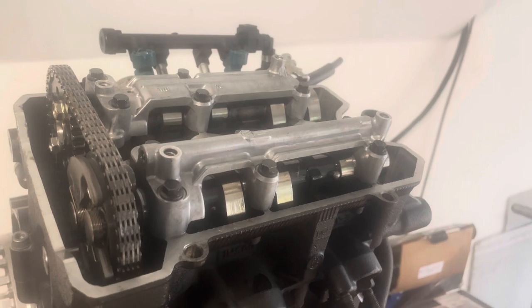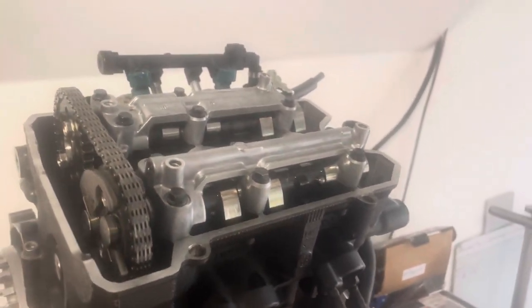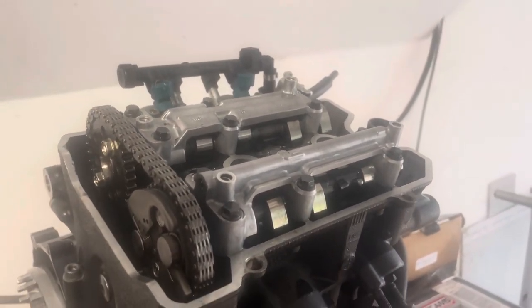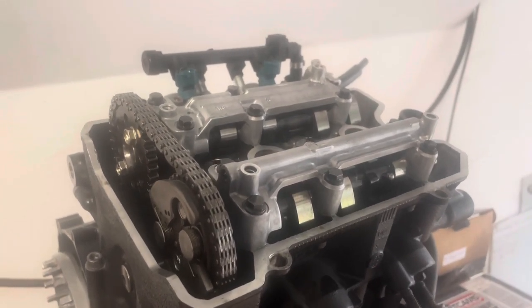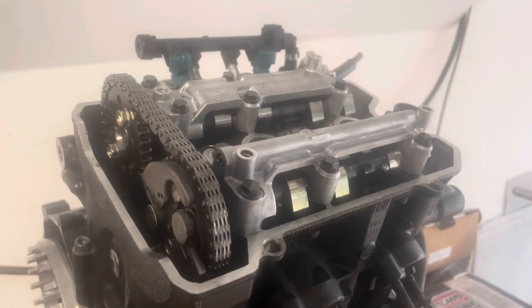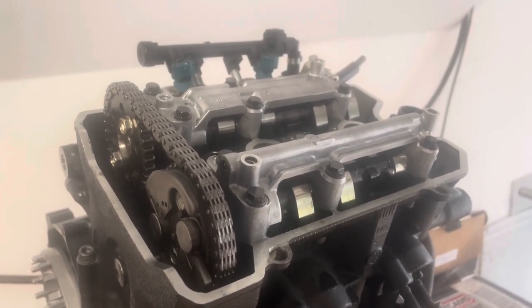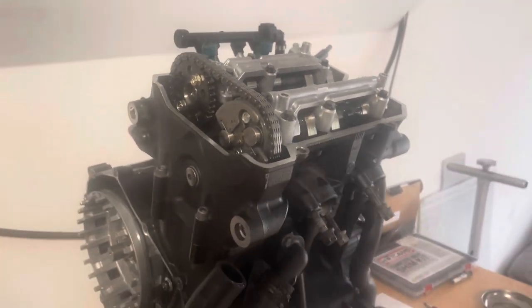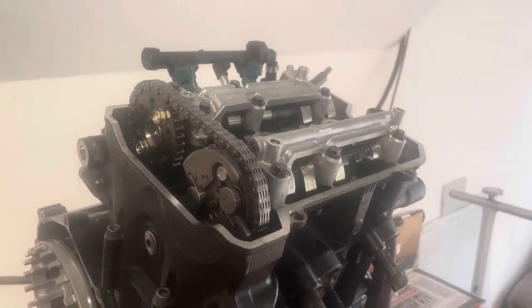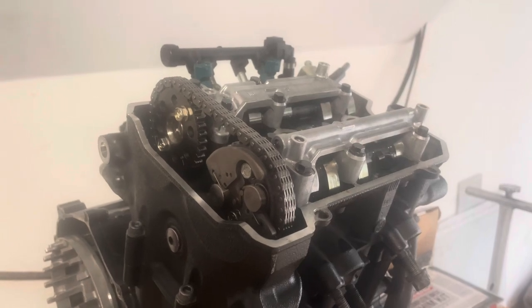It took a couple of tries, but you just get it until it's done and you know it's right. One thing that scares people about valve adjustments is not knowing if it's right — but it's really obvious when you look at it. If you're fairly mechanically savvy, invest in a service manual and take your time. You're not getting paid for it, so who cares how long it takes — take pride in it, because not many people have adjusted valves with shim under bucket. Next I'll be syncing the throttle bodies on the MT-07, which is always a good idea after readjusting valves. Thanks for watching — hit that subscribe or like button.